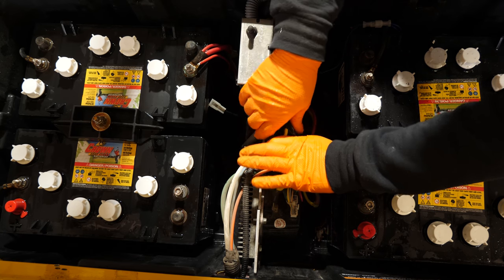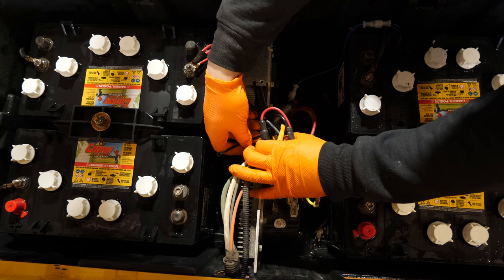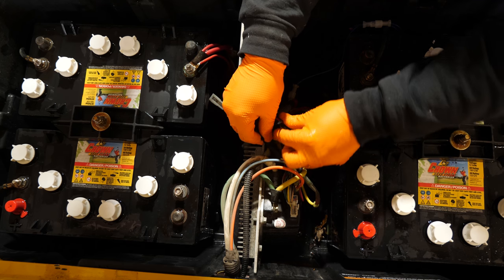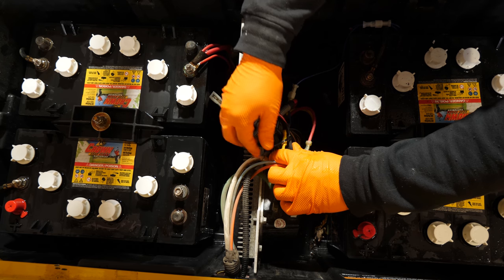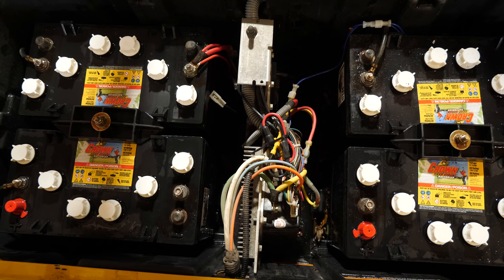You can do a little bit of wire management — they give you a zip tie which I'm going to use. I'll utilize some of the existing wiring here and anchor it. This is also a fused wire connector; there's a fuse right inside that, so if you ever have any issues be sure to check that. It doesn't need to be extremely tight, we just need to keep it managed.